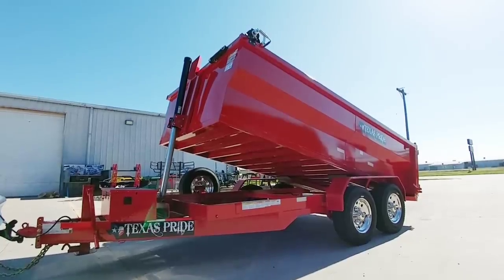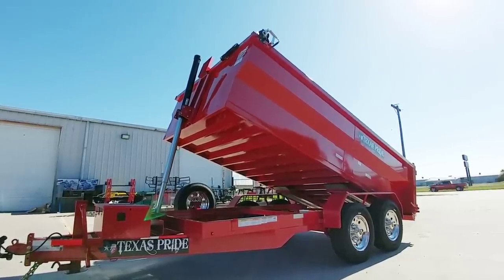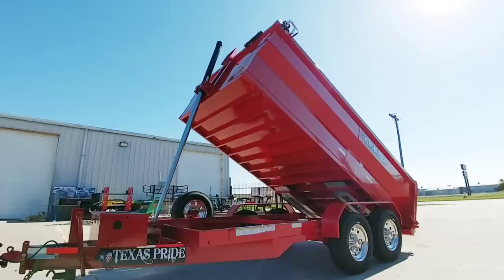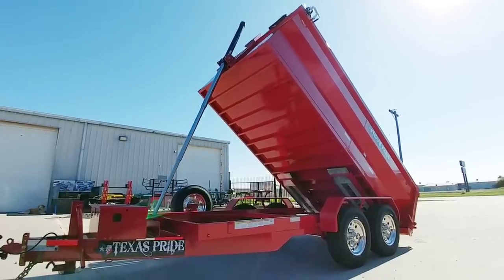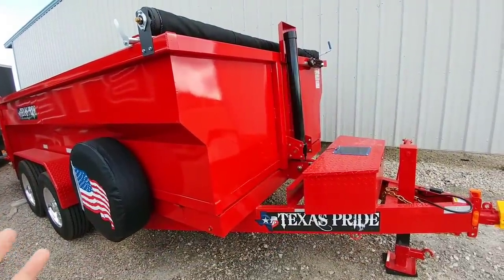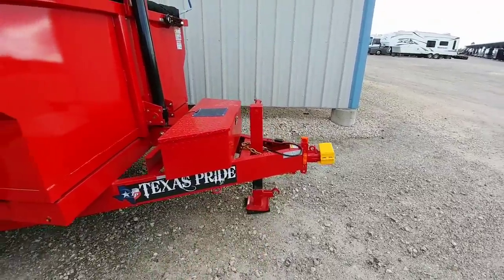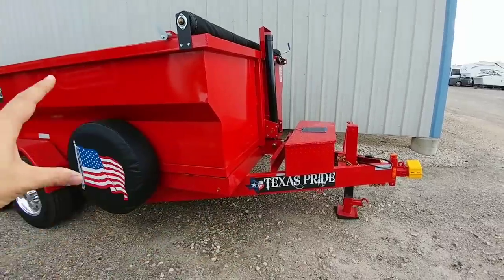Some people wonder what the advantages are of a telescopic boom over a scissor lift or a dual-ram setup. The advantage here is that you have leverage on your side. You're not trying to lift the dump bed from the bottom or the middle portion, which requires you to reinforce the frame structure to support those rams or that center scissor lift. This is the most efficient setup you can get — very similar to a commercial dump truck, which puts the ram at the front as well. This provides telescopic leverage that pushes up from the front of the trailer, putting a lot less stress on the frame. It supplies the full lifting force directly to the dump body, which is what you want.